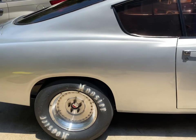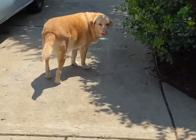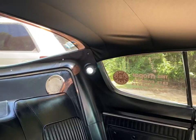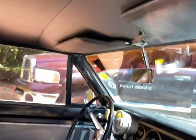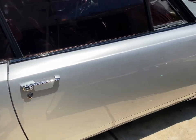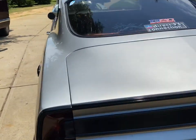I had one of my friends come over and help me out — he polished the wheels and polished the door panels for me while I was doing everything else. They turned out a lot better than I thought they would, honestly. I got the interior all nice and cleaned up, got all the door panels on there, window cranks on the back with Christmas tree clips since I don't have armrests. I put LED lights in for the dome lights, got a new passenger visor because the old one was really beat — the stitching was ripped and it was falling apart. The door panels are a little rattly because I didn't put any sound deadener or plastic sheeting behind them, but it cleans up pretty good.